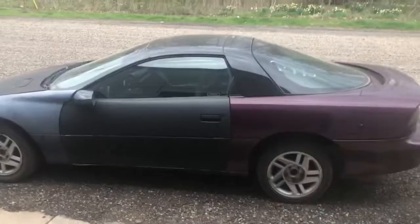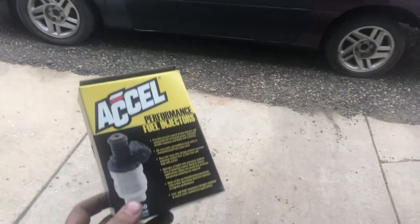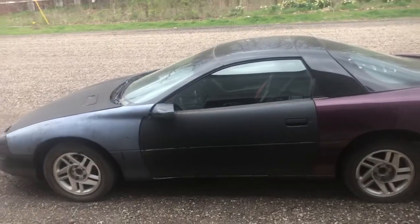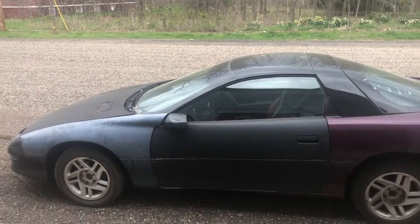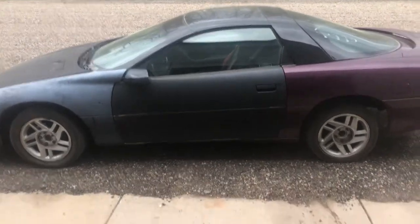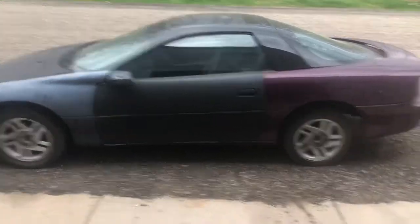Next vehicle I'm going to work on is the '96 Camaro. I'm going to try a different set of injectors — 30-pound injectors — because I think I've got a sticking one. For whatever reason when it runs it runs super rich, and you've got to rev it up a little bit to clear it out, then if it idles for a little while it starts to flood itself out again. I also need to get my summer rims on there because those tires are shot.